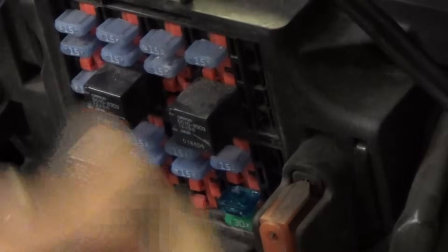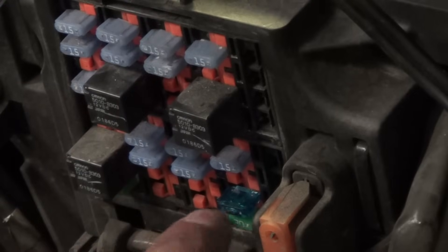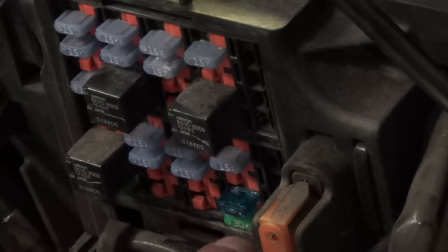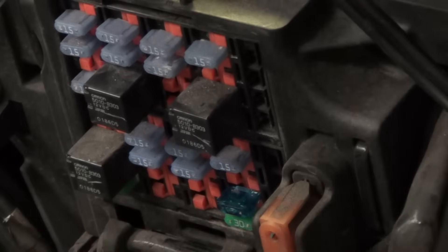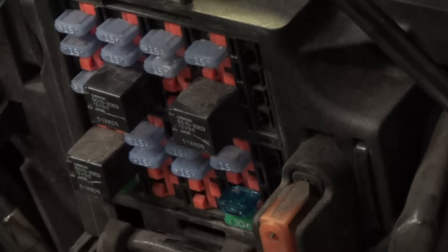That's where the spares are. These are just the mini fuses — the 15 ampers are blue, 20 amp, and this is 30. Here's the main 40 amp fuse, right here, the one all the way to the right. They say anytime you work on electrical on the Harley you should pull this 40 amp out. Of course, I'm a thrill seeker — I never do it.